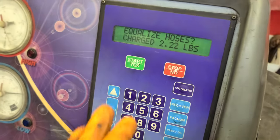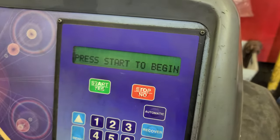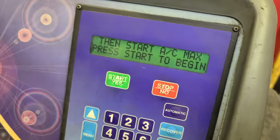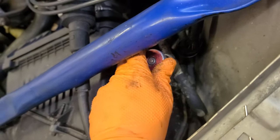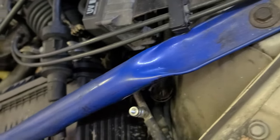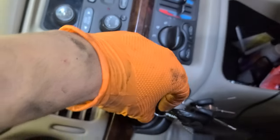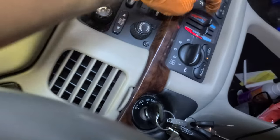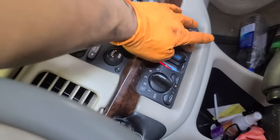That's it — select yes. Disconnect, then start AC to the max. Usually you just disconnect it and that's it, but there's some pressure in there — start the car and run the AC to the max. Now put it all the way to AC, then disconnect the low side counter-clockwise and pop it off.